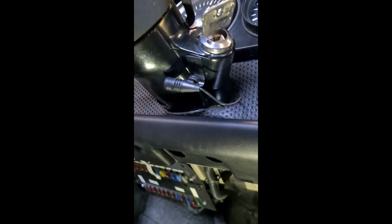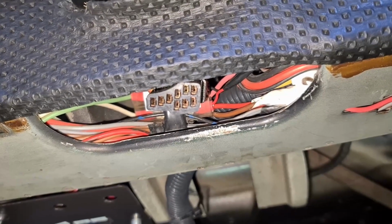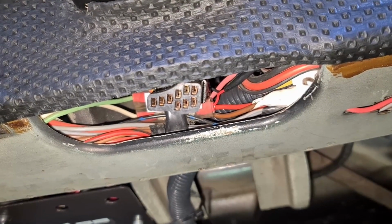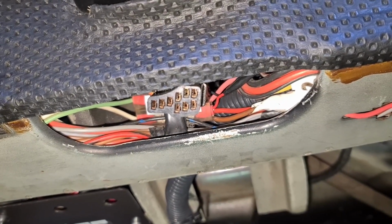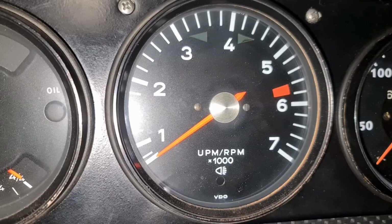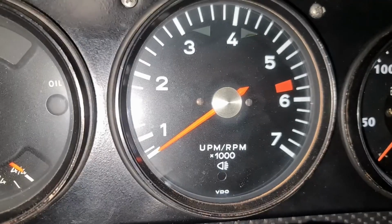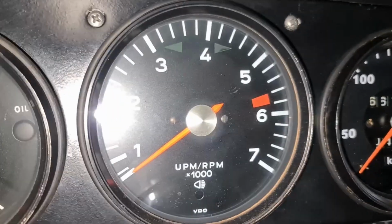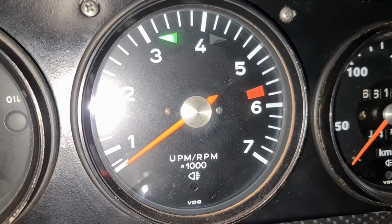So I get to take this off and go and see what I need to do up there, tighten everything up. All right, there's the 51-year-old connector, and it looks like the little copper holdy bits are spread out pretty wide, so I'm gonna tighten every one of those up, hopefully solving the problem for the long term. Well, check this out. Left blinky. Yeah, that's the left blinky. That's the right blinky. Nice and solid. I didn't need this a few days from flying away from America.